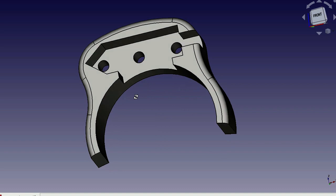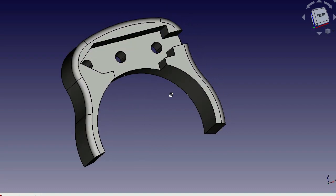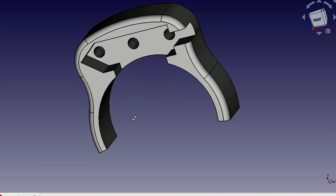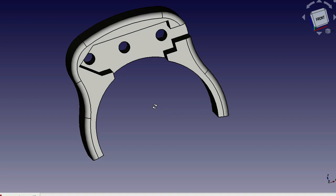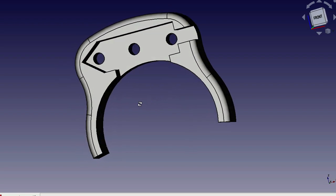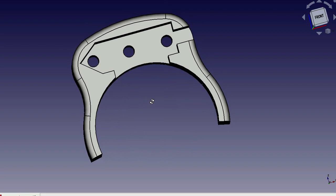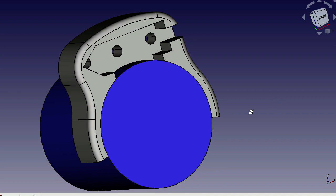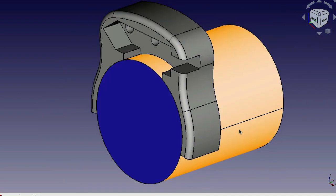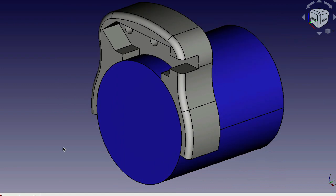Essentially this is going to be a snap fit. You push it and it snaps around the main crank shaft. The sensor should fit inside there, and I put some screw holes in the back so they should just bolt onto it. That's basically the idea. That should just bolt onto there. Okay, so I'm going to print this up and let's see how well that fits.